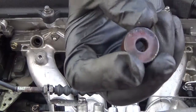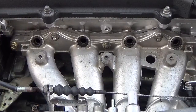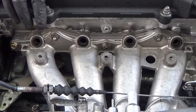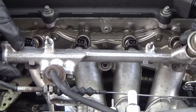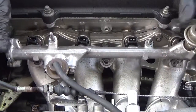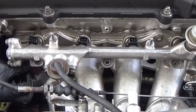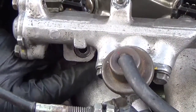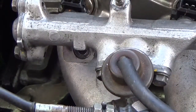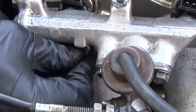Do not forget to put these back on — they're like little plastic washers that go in between the intake and the fuel rail. Don't forget to put those on. So what you're going to do: take your fuel rail, put it right back, put the injectors back in their little homes. What you're going to do with at least one side is fit this washer right here in between the fuel rail and the intake, and at the same time put your bolt through. Once you've done that it's good to go — you can just thread it a little bit with your fingers.